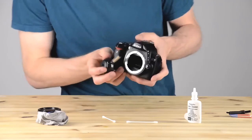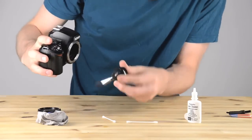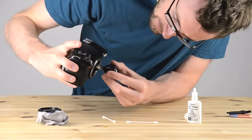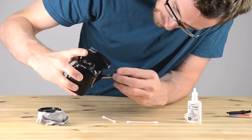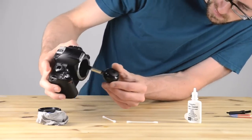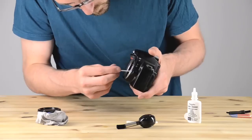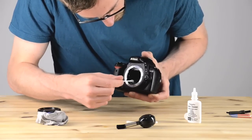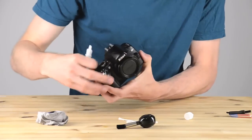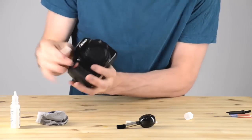Now I'm going to brush off the prism on top. Right underneath the Nikon logo there's a flat surface with a prism that you look down through onto a mirror. Now I'm brushing the mirror off — both will get dust on them. Cameras are electronic things, so dust is attracted to them just like with TVs and computers; dust gets sucked inside as soon as you open the camera and sits on the prism and mirror, and in bad situations on the sensor. I also go in quickly with a super very lightly dampened Q-tip and wipe off the mirror, using both ends so it dries it off as well.